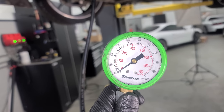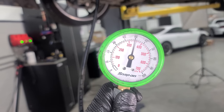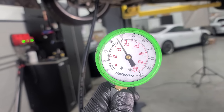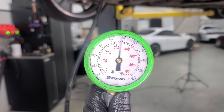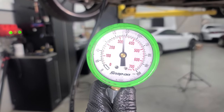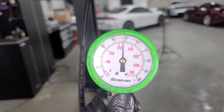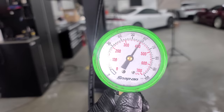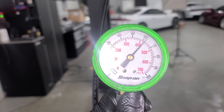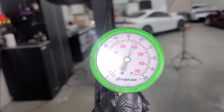Come on, baby. Come to life. Yeah! We got about 50 psi at cold idle. At about 2,500 RPM that's great. We did it! We got good oil pressure. I've let the Porsche run for about 30 minutes — it's at full operating temperatures, fans have come on and off. We're at about 25 psi hot idle. Revving it up to about 3,000 RPM, we're getting like 45-50 psi hot. Listen to this engine — no noise whatsoever. Sounds absolutely perfect with our awesome exhaust.